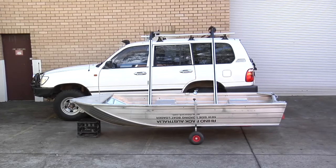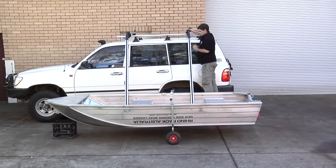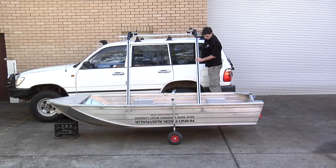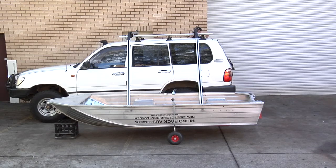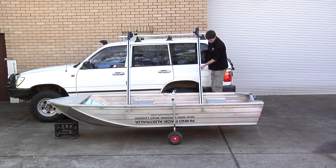At this point, we're going to fine-tune the position of the top sliding crossbars. To do this, you need to loosen the smaller side of the bridge support clamps. Now adjust the top sliding crossbars to the desired position using the fitting instructions as a guide for clearances. Once you're happy with the position of your ramps and the top sliding crossbar, tighten the bridge supports back up and once again make sure the system is still square and parallel.